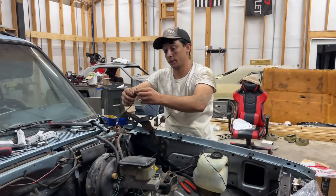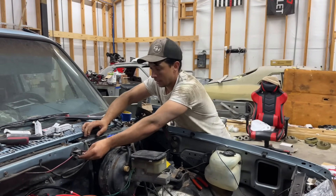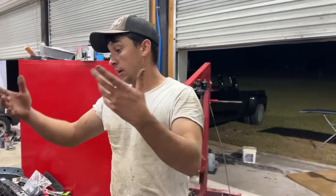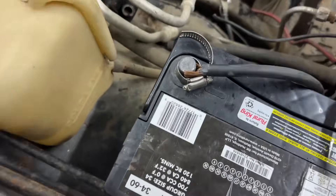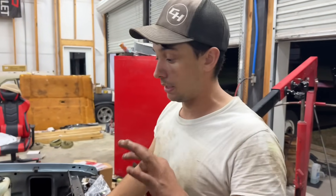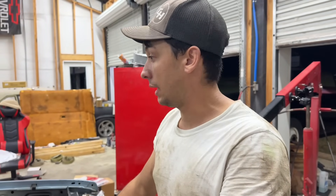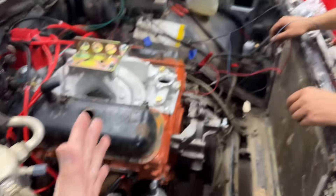It's been a long day, but we're fixing to try to fire this thing — spin it over with the key. After a whole lot of time looking over wiring diagrams, we figured out which wires go where. We've got the coil wire in, the ignition wire to the starter, the constant 12-volt that supplies power to the inside, and our ground. All of that is hooked up. First, before we try to fire it, we're going to spin it over without fuel to build some oil pressure since it's been a long time. Then we'll bolt the carburetor on and put a little fuel in it.